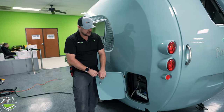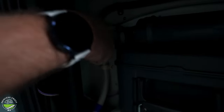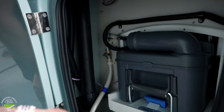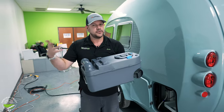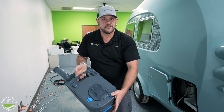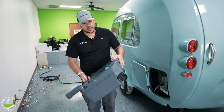Moving on down the side, this last compartment on the exterior is for our black tank or our cassette toilet. Inside we have our cassette and also a water valve — this is actually a water shut-off to the toilet itself. Turning it allows water to flow to the toilet. To remove the cassette once it's full or when breaking camp, make sure your flap inside is closed, lift up on the blue tab, and pull the cassette out. Take it to a dump or toilet, rotate the spout out — this is your holding handle — and this little button is a vent release. If it's very full and you're trying to dump it, it's kind of like dumping a water jug too fast; push that button to allow fresh air in so it doesn't gurgle. Push that down and dump it out. For extra cleaning, remove the cover and turn the little blue knob, which opens the flapper in the cassette and allows you to spray it out. The cassette also has wheels and a handle, so it can be set down on the ground to make transport easier if it's heavy. To put it back in, make sure everything's closed up, slide it back in wheels first, and push it all the way in until you hear it latch.